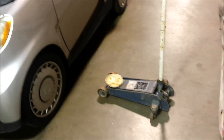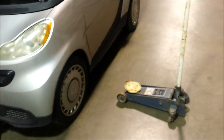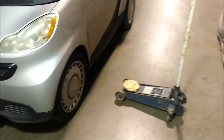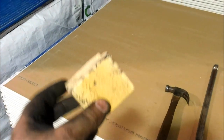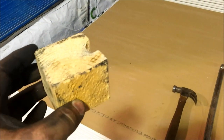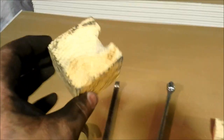I've got my floor jack and jack stands, though I didn't use the stands - I just throw a couple tires underneath. You do need something for safety, but I don't get the car up high enough that my regular jack stands will work. This is a little block of wood that sits on the floor jack and goes up in a little recess under the body - about the only place you can jack up without having to remove all the plastic ground effects.